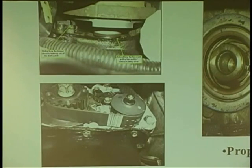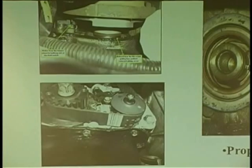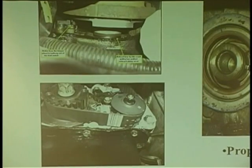And I had a car not even last week. Go with your first feel. Guy hires me. Poop, pop, pop. I'm like, dude, this thing's out of time. It ain't out of time. Dude, it's out of time. I'm telling you, my first feel. Pressure comes out of the hole where air is supposed to go this way. It's coming this way. That's out of time. It's farting in the intake. It's firing at the wrong time.